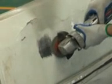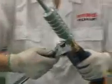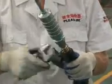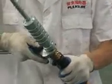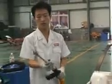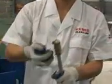Triangular piece function. The triangular piece function is for small dent parts of the car body. Before the triangle piece welding, please clean the rust and paint off the dent part to make the triangle piece contact well with the iron plate. Then, install the triangular piece pulling hammer to the welding gun. Here, please pay attention to the triangular piece installing.